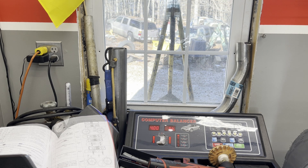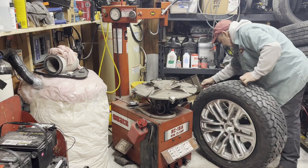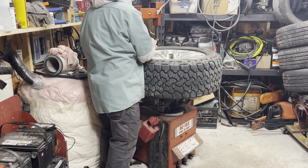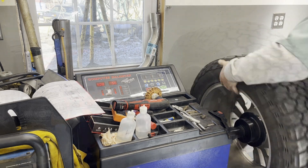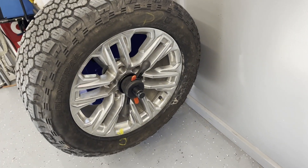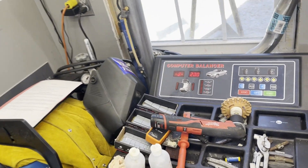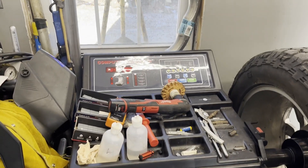Back to the tire machine and then back at the balancer. We're going to spin it up now — we've got the D position, C on the tire aligned to D on the wheel. According to the instructions, this ought to be less unbalanced weight than before. Let's give it a spin and see what we get.